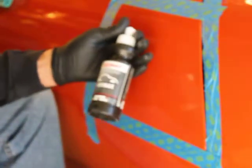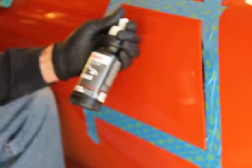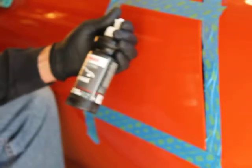That'll take off those scratches, and then what I'll do is I have a Rupes 15 ES, which I'll put a Meguiar's microfiber cutting disc on, on recommendation from Todd at Esoteric, and I'm going to be using it with the Sonax Cut Max. Found it works really easy. You don't use a lot of product, and it's amazing how little product you use.